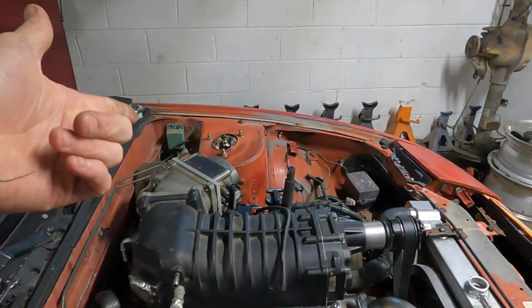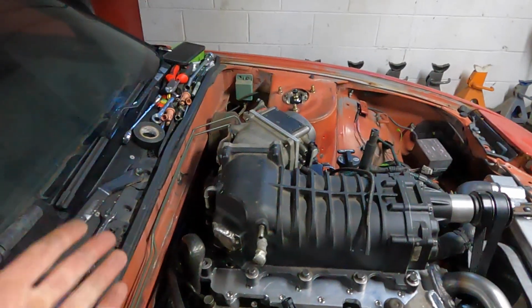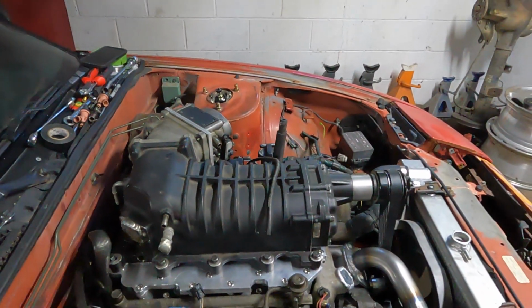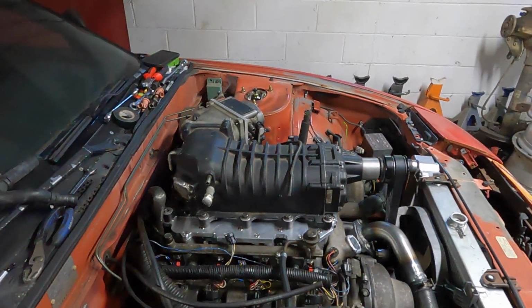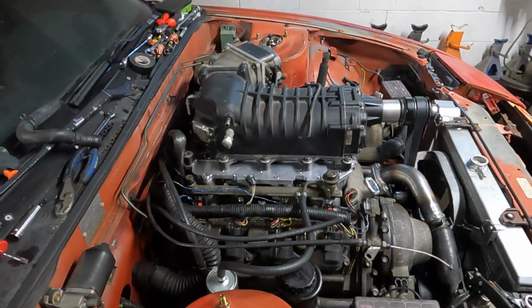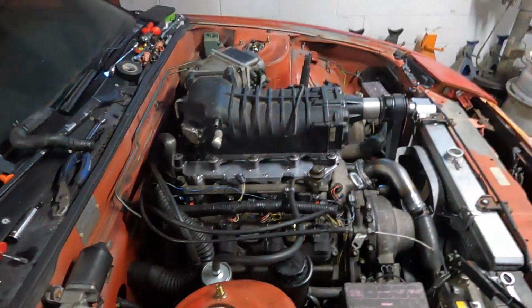So I'll get that drilled out. We'll get the throttle cable on. I'll get a fitting for that. We'll get it hooked up. And if we get all these vacuum leaks hooked up, I got to change some stuff in the programming, because this had 275cc injectors before. Now it's got 550cc injectors. And it's a standalone, so it's not a crazy process. Nothing that weird. I've also got to scale it for boost now, because it was just naturally aspirated.